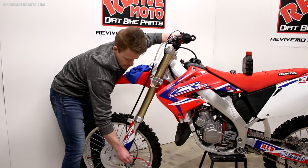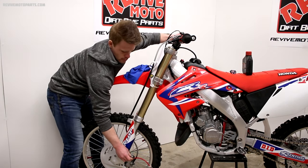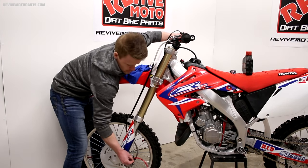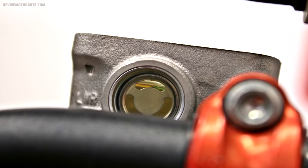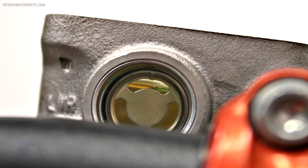Repeat this process until you feel the lever has adequate pressure. If you've just replaced the brake line or caliper, you're going to have to do a lot of bleeding to remove all the air out of the system. Continually check up on the fluid level at the master cylinder — if you run it dry, you'll just let more air into the system.